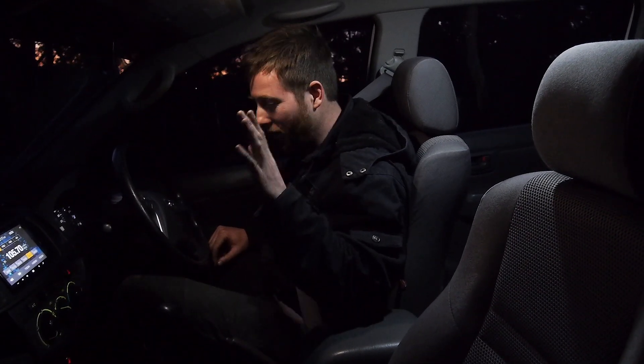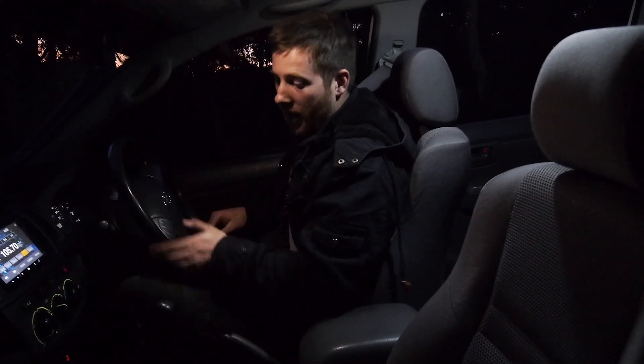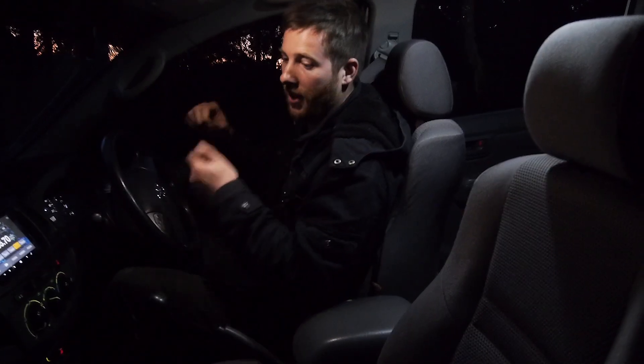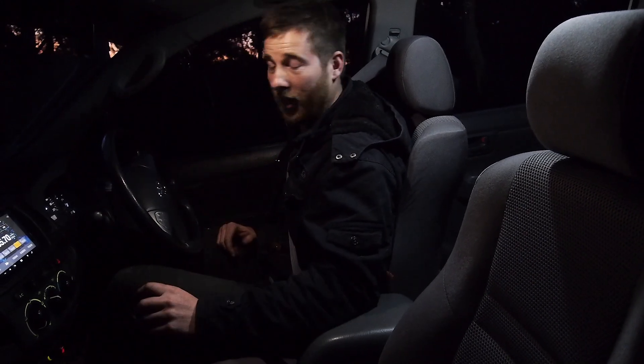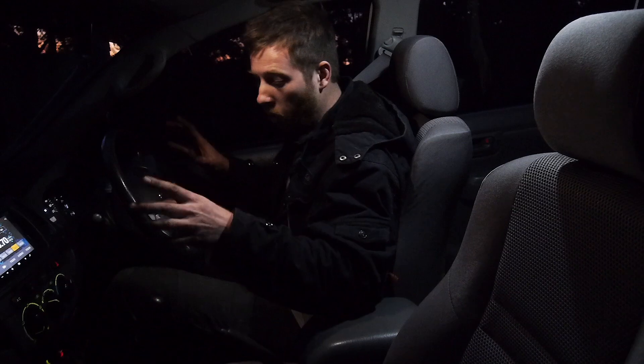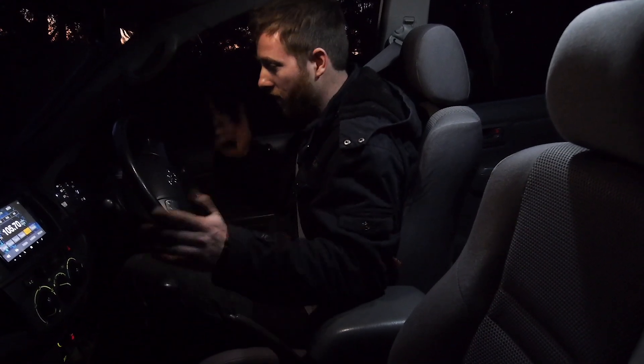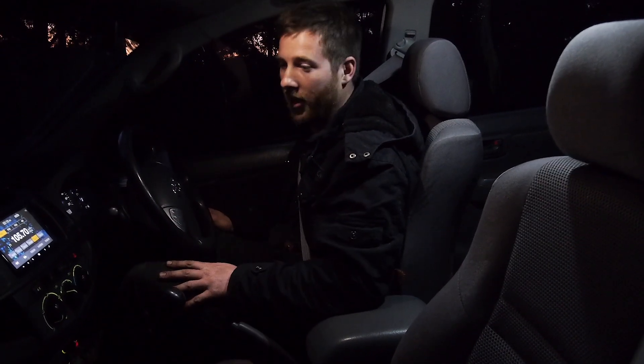One thing — and please, please, please do not make this mistake. Whenever you're leaving your vehicle, if you're facing downhill like we are, turn your wheels into the curb and handbrake on full, and put it in reverse. If you're facing up a hill, put the car in first gear and also angle the wheels to the curb. Things fail — handbrakes fail, I've seen it many times on many different cars. Basically you don't want to roll your car or hurt someone. Even though it works, do not solely rely on your handbrake. But I've got complete faith in it and I've been testing it for quite a while now. It's just good practice to always leave it in gear and have the wheels pointing into the curb — just so if anything happens it'll be a lot safer and it won't go rolling down the middle of the street.